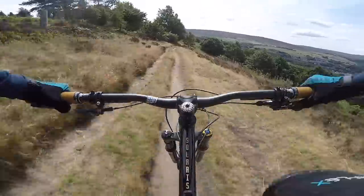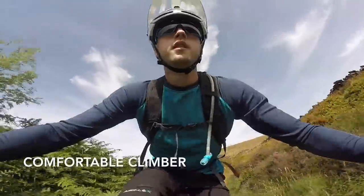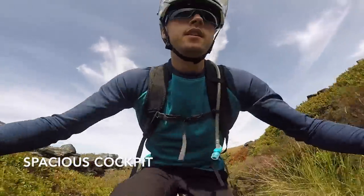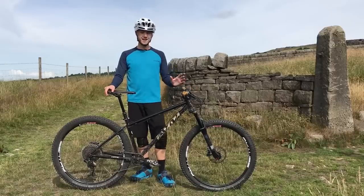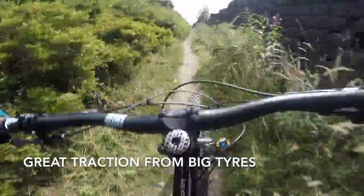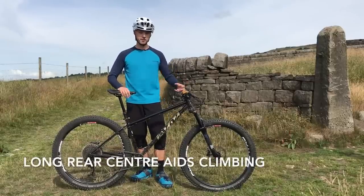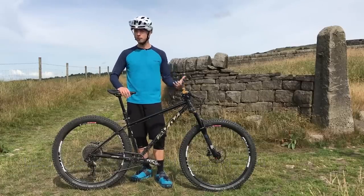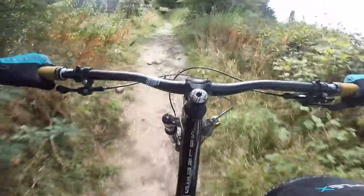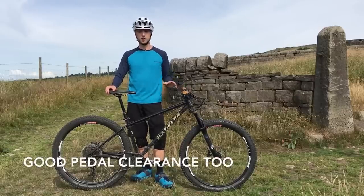So how does this bike actually ride in terms of cruising along and climbing? It's a pretty unassuming steel hardtail. It's not the lightest bike in the world, so it's not going to set any records on the climbs. However, it is really comfortable to climb on and a lot of that has to do with the big open cockpit that gives you plenty of room to move around on. You never feel cramped, even going up steep fire road climbs. It gets even better on technical singletrack climbs. There's a load of traction from these big tyres, which helps when the trail surface gets rough and loose. Because of that long rear centre — that 444mm chainstay length — this bike is actually really planted on the climbs. Typically a slack head angle with a short stem results in a light and potentially wandering front end, but the long wheelbase keeps it really steady and stops the bike from tipping backwards on steep pinches. Technical climbing is actually really good, with good pedal clearance even on rutty and washed out terrain.